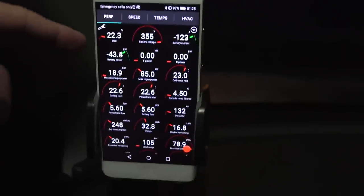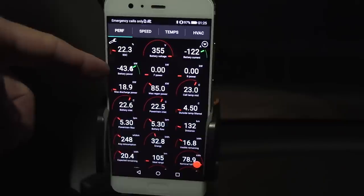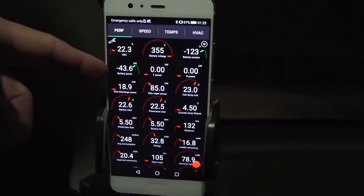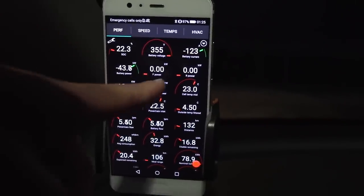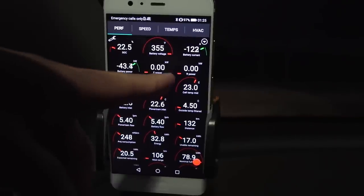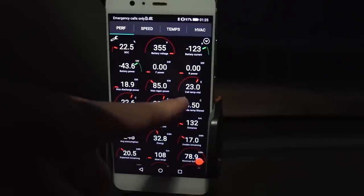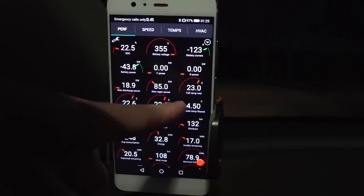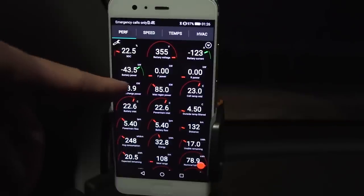It's beautiful. Because what would happen before was that we would not get 44 kilowatt into the battery. We'd get 35 or something like that. And then these two afterburners would be sucking 7 or 6 kilowatt, just heating up the battery to 40 degrees for no reason. And let's say if you want to just top up for 5 minutes, then we don't care about it.